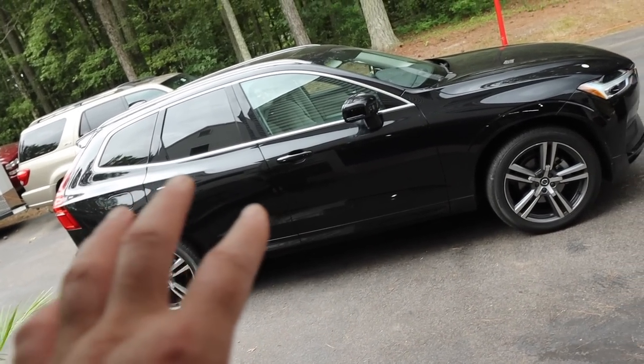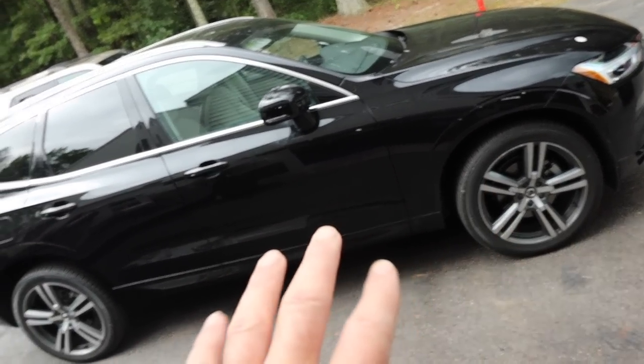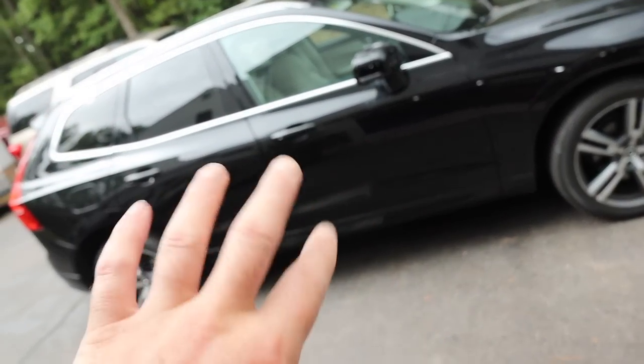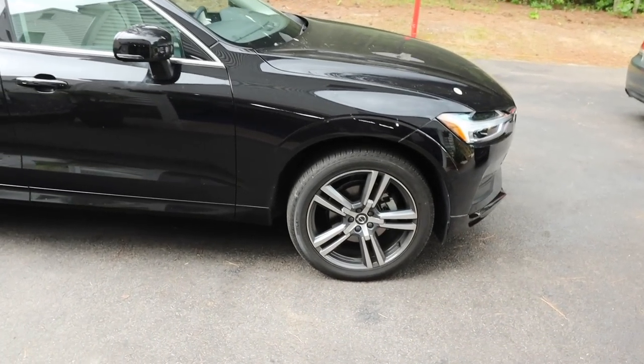And that's going to soften all of the dirt and junk and traffic film and grime on the paint. And then we again blast it off. Now it only sits there about 30, 60 seconds at the most. That's enough time to soften up all of that junk.